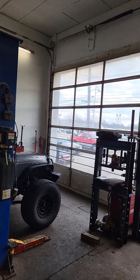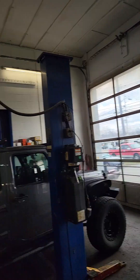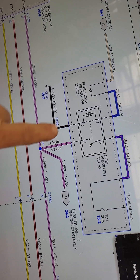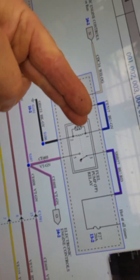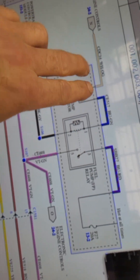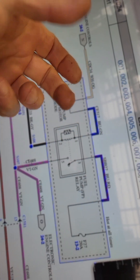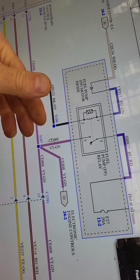Welcome back. Just to follow up with the F-150 towed-in headache fuel pump job — the customer pulled up his own fuse box and cut the blue and green wire in half, which is switched ignition, hot and starter run. When he cut that off the top of underneath the fuse box, he moved that circuit to 12-volt constant and added his own 20-amp fuse. On top of it leaking fuel, he said it kept blowing fuses.